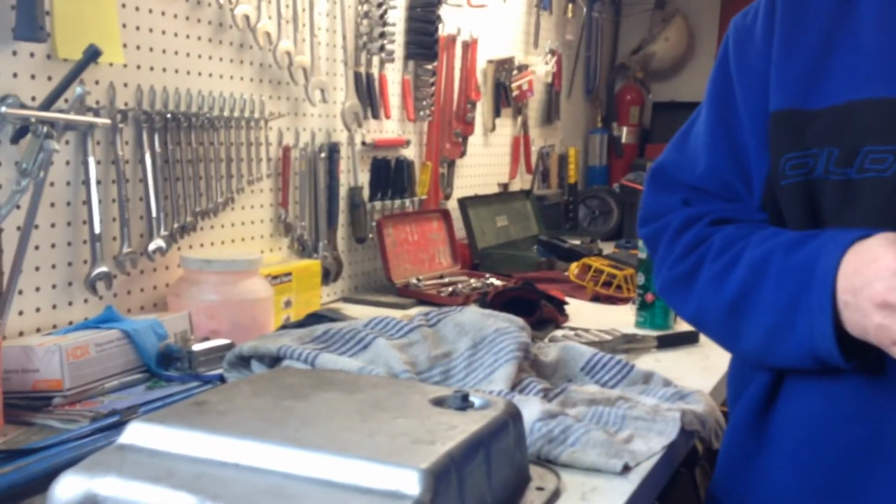So that's what worked for me after a lot of trial and error. What ended up working was the MIG welder and an air ratchet, and it came right off. So I hope this is helpful to you. I've seen a lot of YouTube videos about how to get the oil pan off and different things with your Chevrolet Suburbans or probably your half-ton pickups or whatever. But this bolt that came on here was an engineering disaster. And so I'm just going to discard that and let that go away.